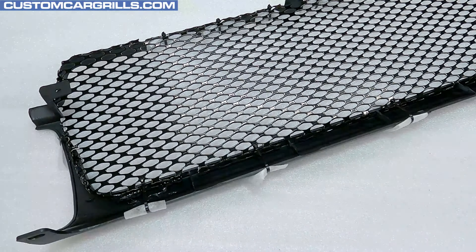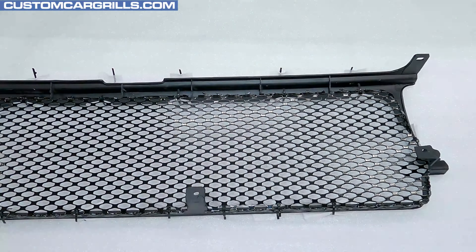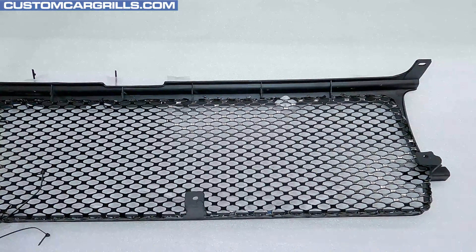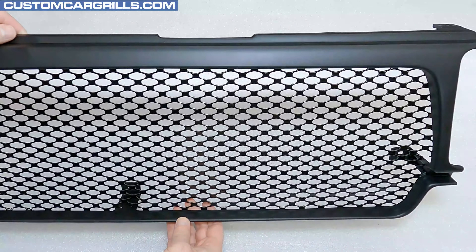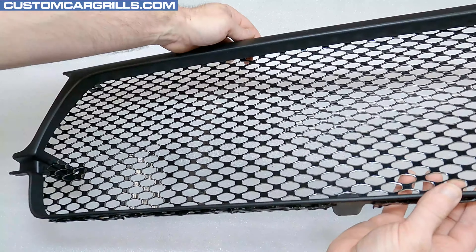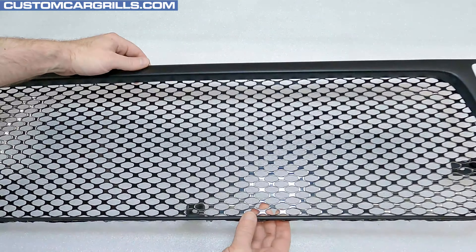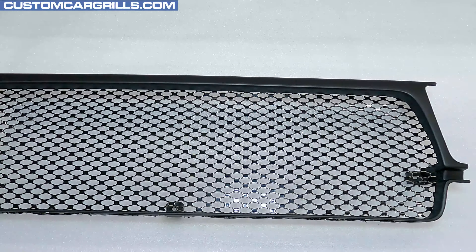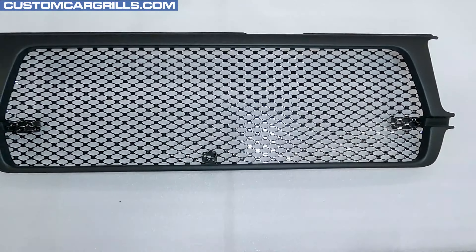I like to wait about 30 to 45 minutes when using the Plyo Grip plastic repair number three for it to cure. Afterward, I'll come back and cut off the ties and throw them away along with the protective foam pieces. The mesh install is now complete — wow, this looks great. The mesh transforms that old looking grille into something slightly more modern, and the chrome to black swap is a big departure from what we're used to seeing on these. This looks like a seamless blend between mesh and grille frame. In addition to this early model grille, I also made a late model grille too, and these mesh pieces and grilles are not interchangeable between early and late models, so please be aware of that when doing this mod.